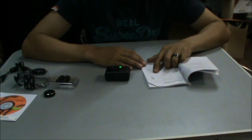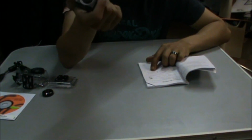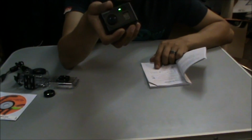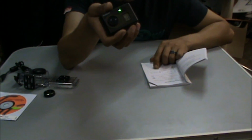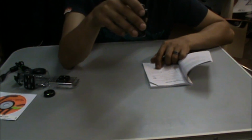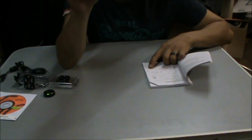Resolution 4, 16:9 wide angle standard, so you're looking at SD video now, so WVGA 848 by 480, and Res 5, which is its poorest quality, will be, oh, in fact, no, sorry, I tell a lie, it's not as poor a quality. WVGA is the next one. Res 5 is 4:3 tallest HD video at 960p, so that's 1280 by 960.